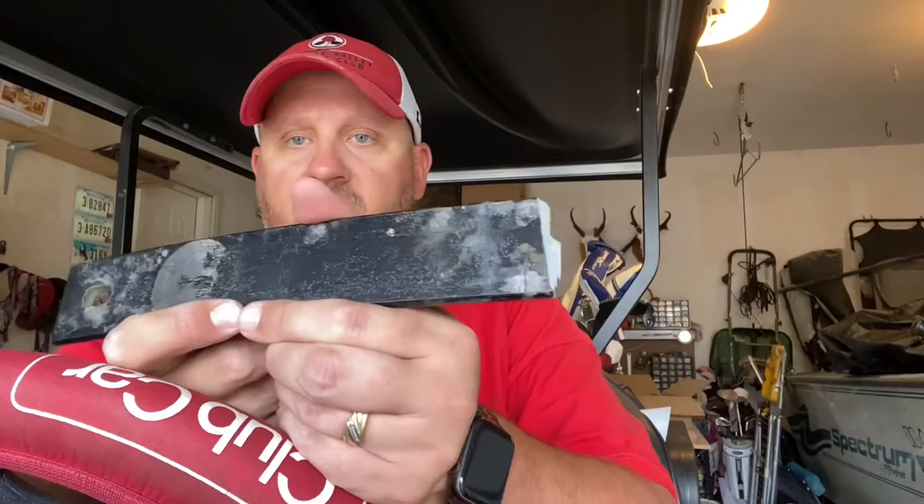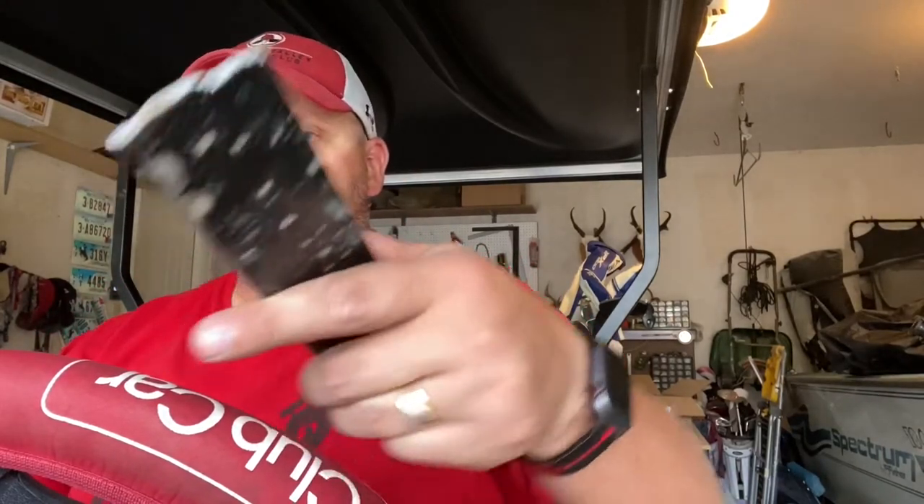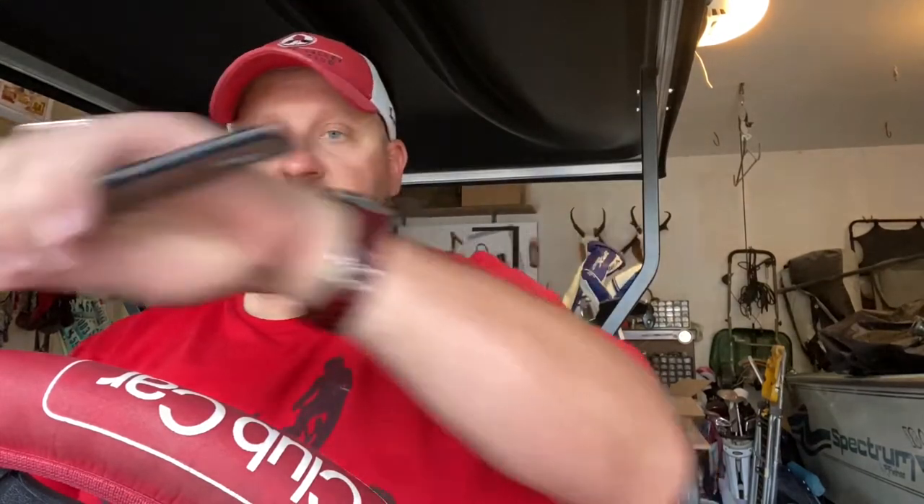You might be asking how you break a leaf spring like this. I'm just not sure what failed on this. If you look at it, my guess is that it was poorly manufactured and had some poor treatment in this area — maybe some surface cracks that rusted out. You can kind of see a little bit of difference in the texture and the grain on there. Really, it's just been cart use, just driving on the golf course. These lifted carts, you hope they have them manufactured right. I love my Club Car Onward. It's been great. Just here recently with the front suspension, it's been a problem. We've got it put together — let's get it on the trailer, get out on the course, and give it a try.